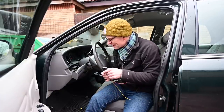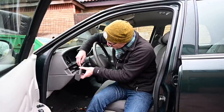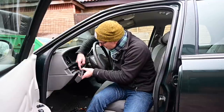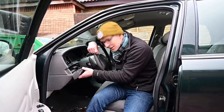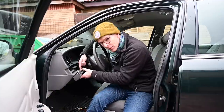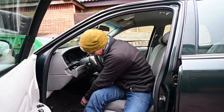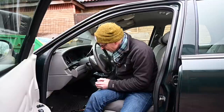I've got to find the right wires and a place to mount this relay. On Crown Vics this panel levers out quite easily and there's a big gap behind it, because there are two pre-moulded areas for attaching extra switches - one is for moving the pedals back and forth. One of the easter eggs of these cars is that one of those features is always pre-wired, so you just need the switch to instantly activate that functionality. There's a second blank one which I can drill through and mount my fog light switch in - that's one problem solved.